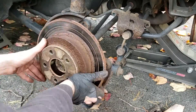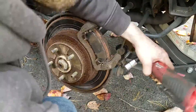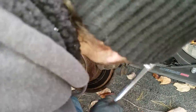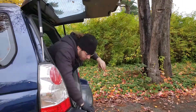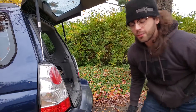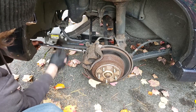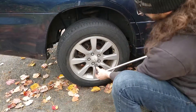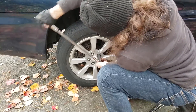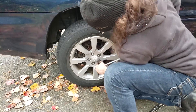Montage time. And now do it all over again on the other side because you love it so much. The only thing that's different is the direction in which you're pounding your breaker bar, which is up. On the driver's side we're doing down; passenger's side we do up. Once your car is back down on the ground when you're done, I sternly remind you to tighten those lug nuts, or else you'll be in a full world of pain when your wheels fall off on the freeway.